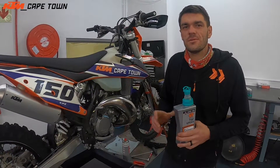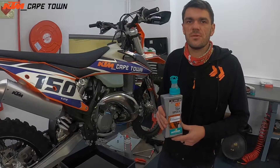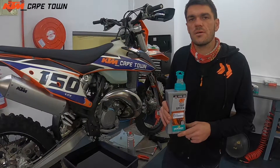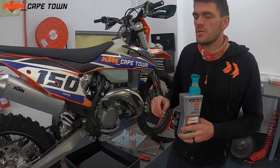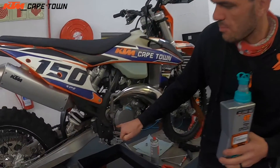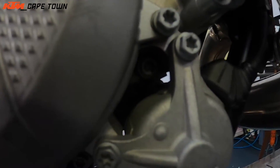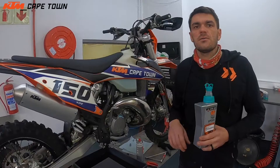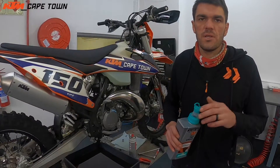Filling the oil on this bike — it takes 800 milliliters. Check your service manual, which will specify the transmission oil capacity. KTM two-strokes from 125 to 300 all take 800 milliliters of oil. To double-check yourself after putting 800ml in, there is a check bolt on the 250 and 300cc models located at the back behind the spring. On the 150 and 125 models, the check bolt is hidden right above the starter motor. Take that out, and as soon as you see oil just about to run out of the hole, you know your oil level is perfect.